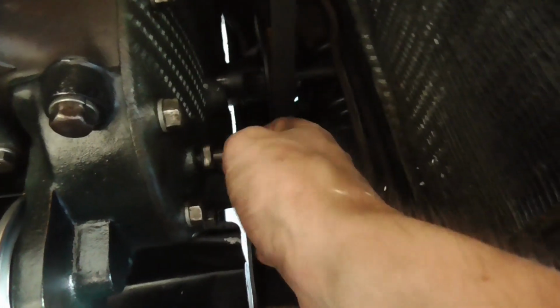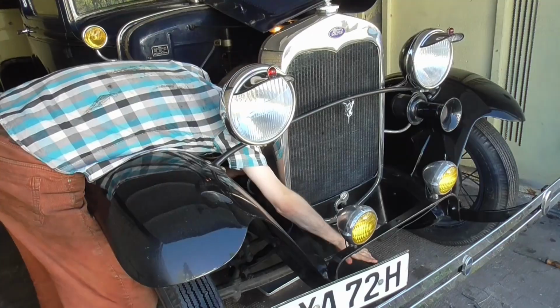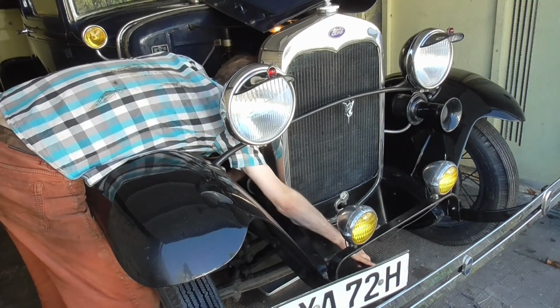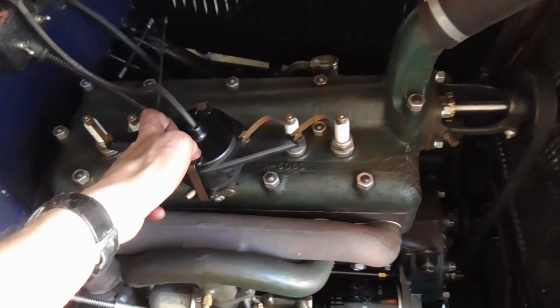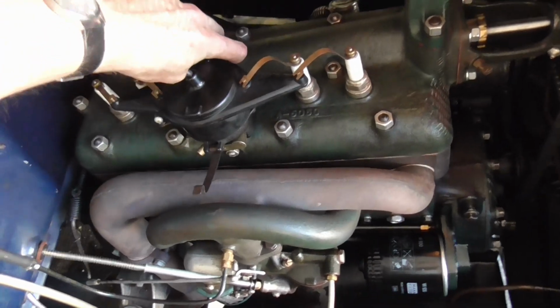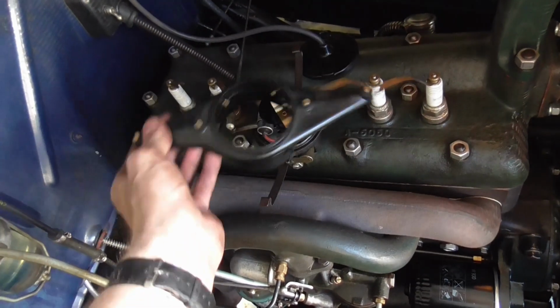You see, the manufacturer of the insert bearings said that it was not advisable to set the maximum timing advance closer than 28 degrees before top dead center. And I did that and well, had all the issues I talked to you about, and now it slowly came around that that was actually meant for tuning applications like a high compression head or anything like that. With a standard engine you would be perfectly fine setting the timing as is prescribed by Ford, because you won't experience any knocking, you won't experience any pinging, and you won't damage the bearings by doing just so.